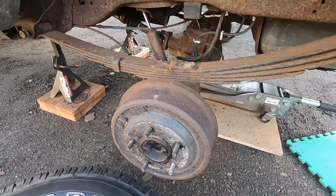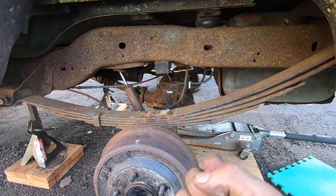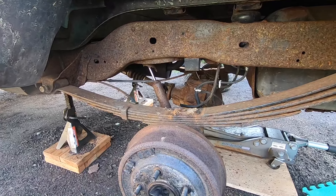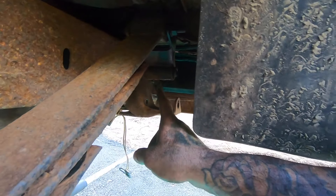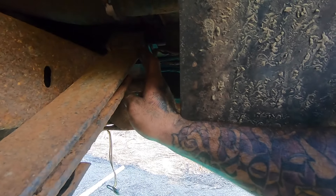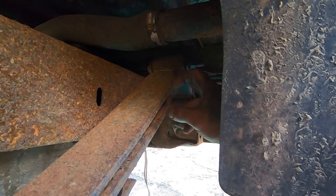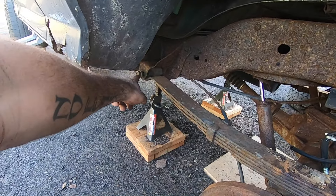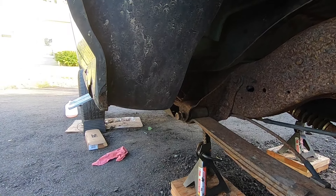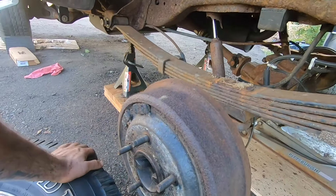Because we're replacing the U-bolts, I just ended up cutting them off. You need to save the top plate for the new ones. Instead of trying to unscrew the rusted bolts I just cut them at the bottom so they split — they will pop off because there's a lot of tension holding the springs down. There's a bolt in here for the leaf spring perch that's moronic how they did it. The bolt only goes out toward the frame, so I have to take the whole perch out and reattach it. Same thing on the other side. This other bolt I've been beating the hell out of and I'm probably gonna have to buy a new one or cut it.